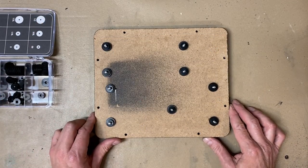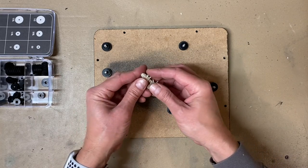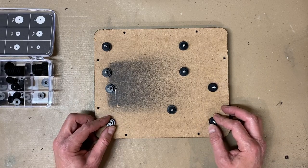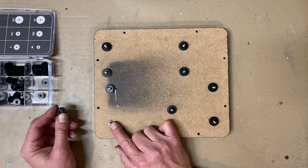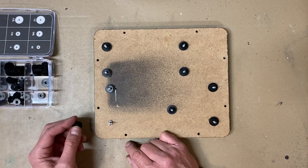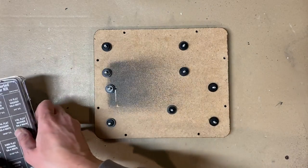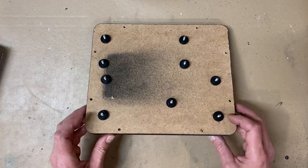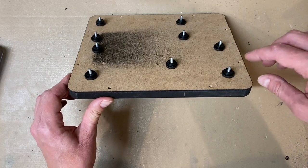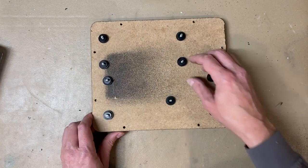Okay, so I have elected to get rid of all the junky plastic standoffs and use the bolt method, which I showed you, using the M4 bolts. And I had showed you originally that I was going to use a nut to create the space, the standoff that's required. Instead, I just got out my assorted washer kit, and I've configured it in this way because you know this cabinet's going to vibrate, and I wanted to make sure that the nut didn't work its way loose and start coming down from the vibrations and then creating all sorts of noise and rattle.